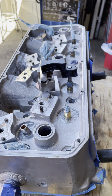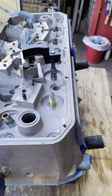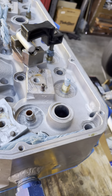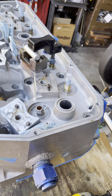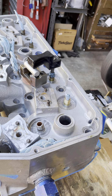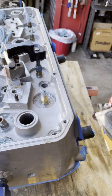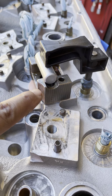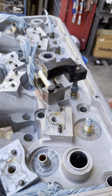So you need to use it this way. I've got some shims here — they're just dummy shims, I'm not leaving those in. I'm going to make the right ones, so you won't even notice they're in there. These shims add up to about 83 thousandths, so that's 83 thousandths of shim needed underneath the rocker arm pedestal. That's another cylinder down.